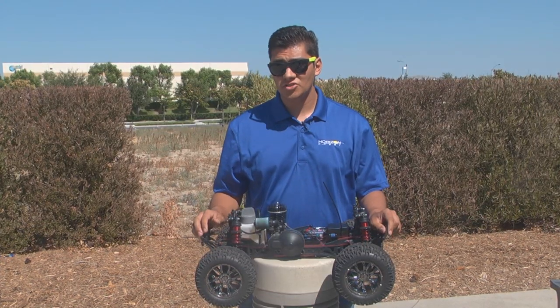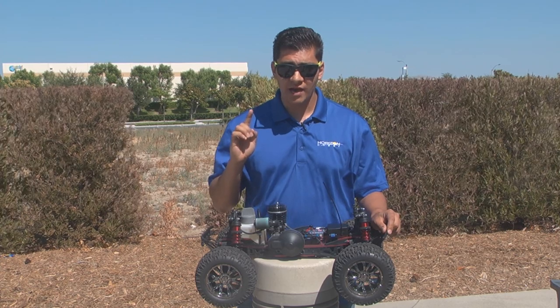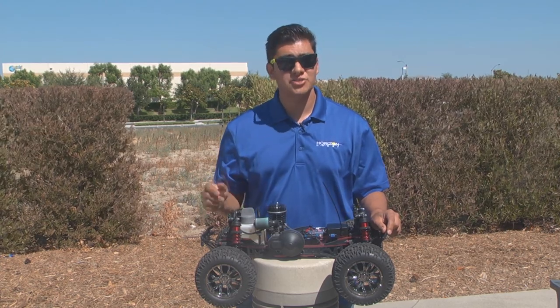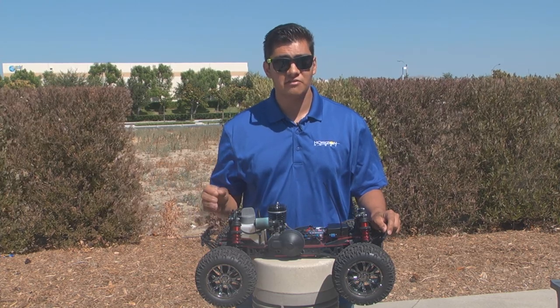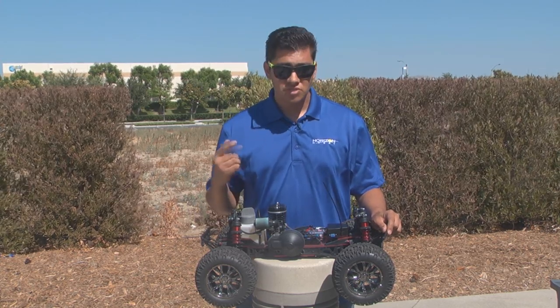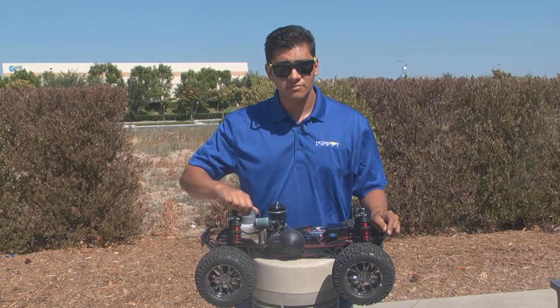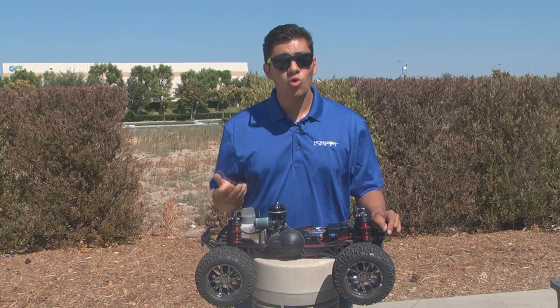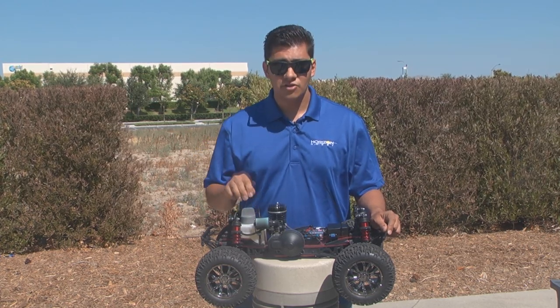As you can see, the reason why it's so easy to tune this engine is because you set your bottom needle by listening to your idle, and you set your top needle by paying attention to your temperature. Your idle screw needle should never be changed — that's there for function only. Quick tip: if your tank isn't fully sealed, if your lid isn't fully closed, that will also cause an erratic idle. So make sure that's fully sealed and you should be ready to go.